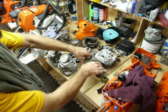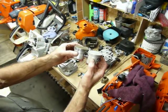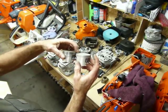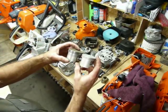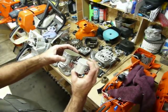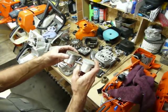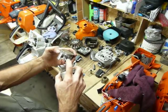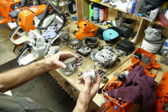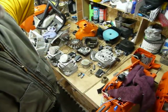Let's look at the pistons real quick. We'll compare a 660 on the right versus a 661 on the left. You can see they use the same 12-millimeter pin. Deck height is way different in the 661 — they've increased it by quite a little bit. Overall height of the piston is relatively close, basically exact. It's the deck height — that's the centerline of the wrist pin to the top edge of the outside of the piston. 56-millimeter piston in the 661, and a 54-millimeter piston in the 066.